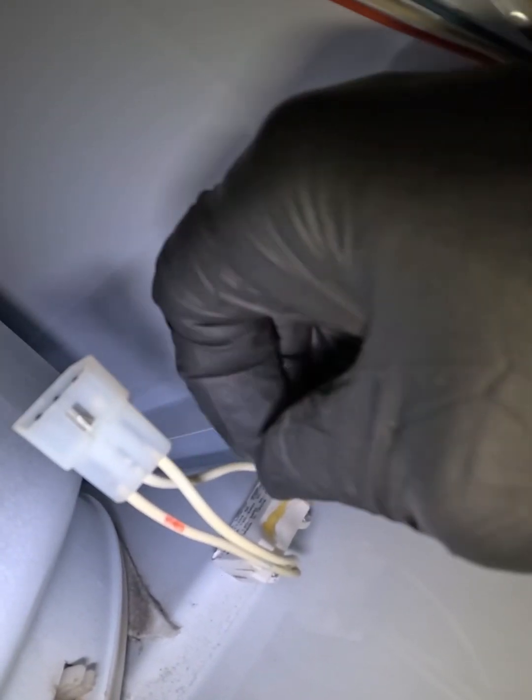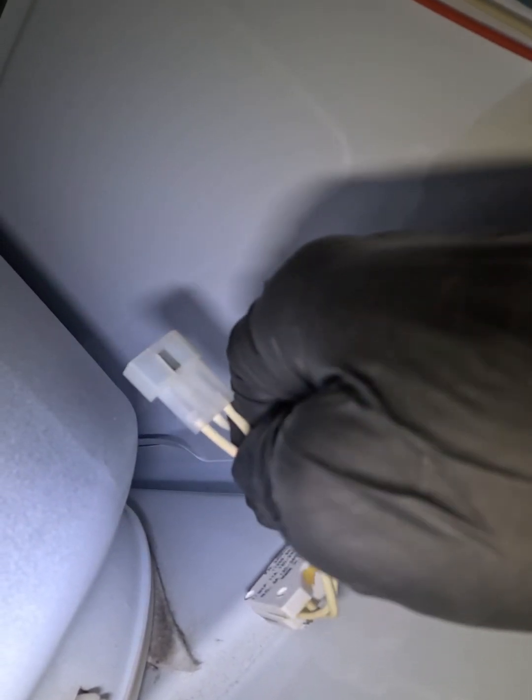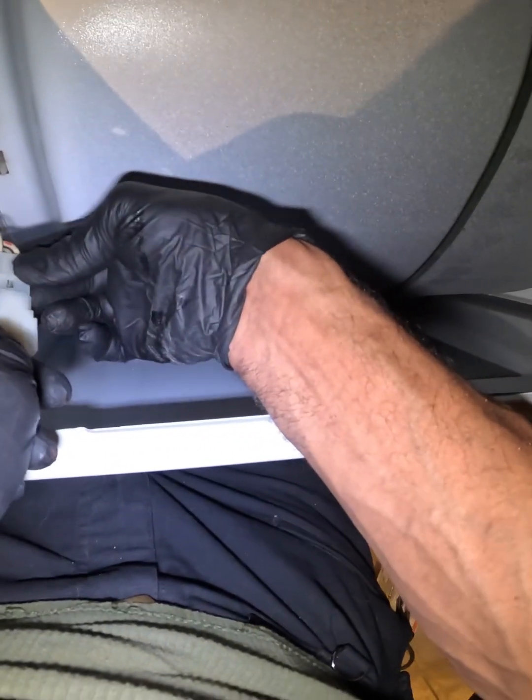What we're going to do is cut those two end wires off — you can leave the light wire hanging or just cut it off. Keep in mind the dryer will now run with the door potentially open, so if you open the door while it's running it will still run. Look at the wire colors to identify which is which.